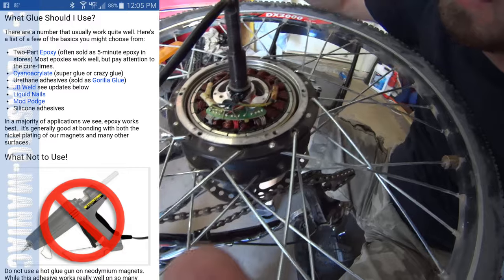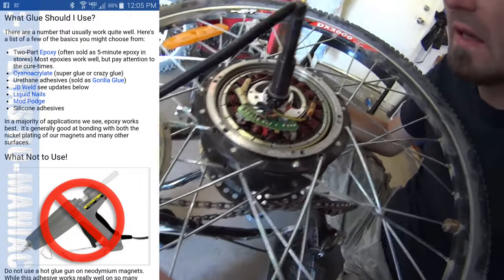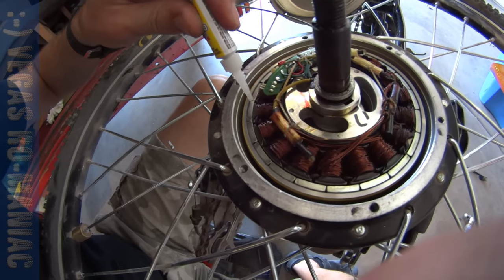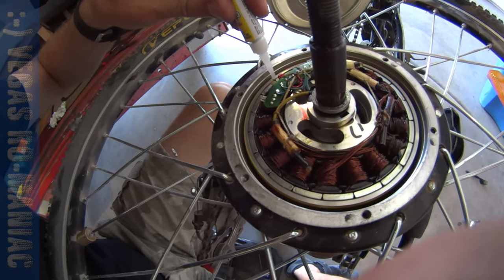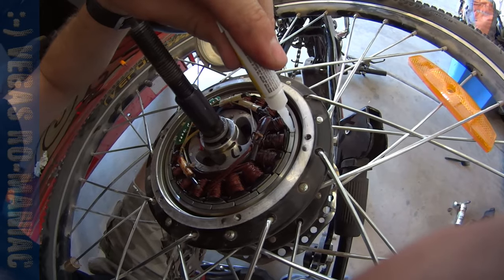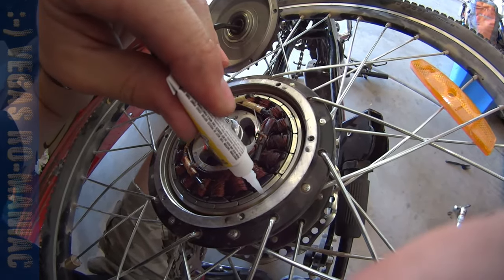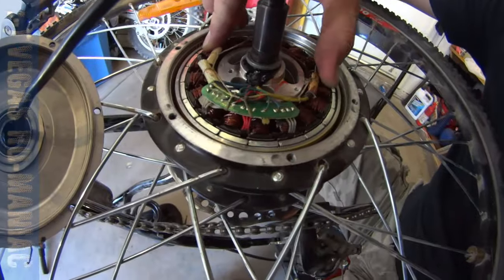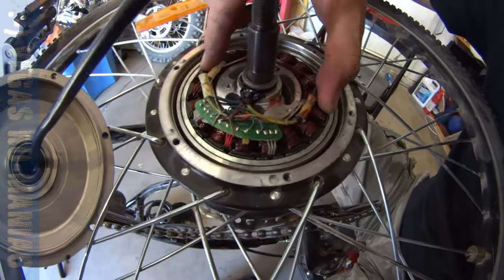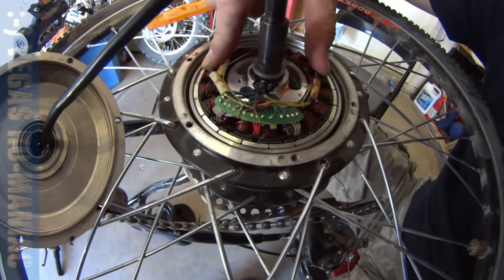If this fix with super glue is not going to make it work, I'll have to take it all apart and see what I can do to fix it even better. But I hope that super glue will keep it all together in place. I'm going to add super glue in here and it should just hold them enough. Because it's a liquid, it should create a barrier in there. It's very important not to put too much and not to glue them to the motor itself — the motor still has to spin. You should not glue the magnets to the inside where the electromagnetic field is formed. Make sure you glue them on the outside — very, very important. Spin it a little bit while it dries just to make sure it doesn't catch.